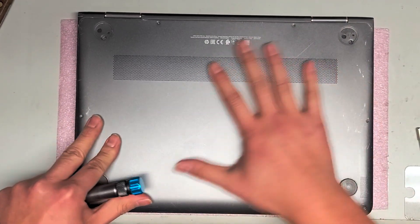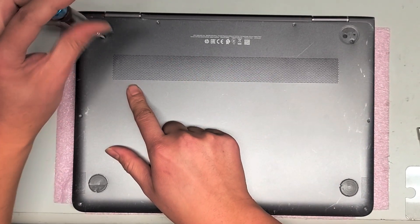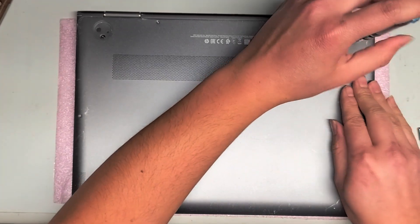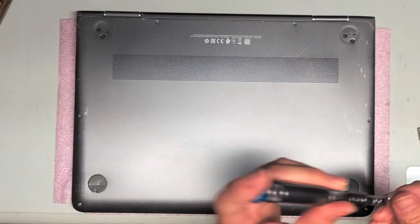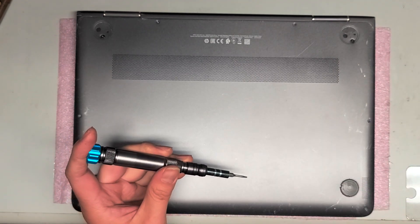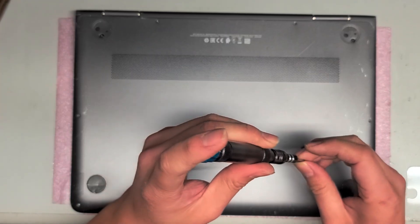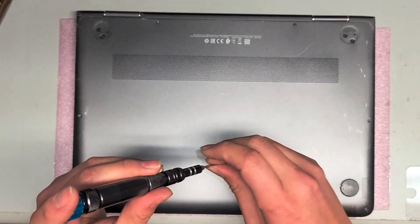Slide that underneath and clip it down, then put all the screws back in. If you are upgrading or replacing the SSD, make sure to either clone the SSD first — I have a video on that — or create a bootable Windows installer and do a clean Windows install. If you're upgrading the hard drive, clone it first. Otherwise, your computer won't start up — it'll say hard drive not detected, or operating system not detected, or it'll just stay on a blank HP screen.